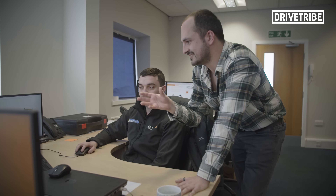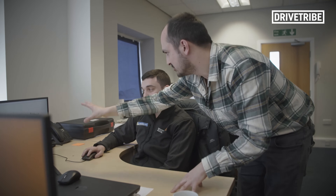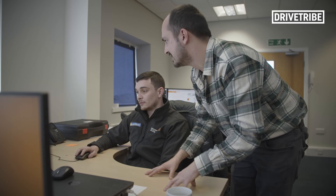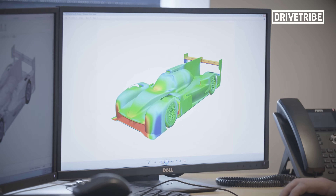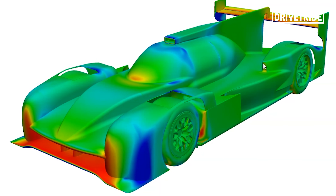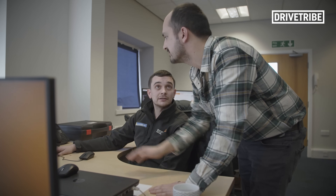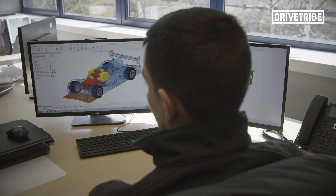That classic regulation of having a passenger seat in the car still exists for Le Mans — exactly. So if you look at our own P1 car today, we have to make sure the driver can get in and out both sides of the car. With the CFD model, you're simulating a wind tunnel essentially. What are you looking for in the CFD image? We're looking for a good correlation between what we thought would happen with our surface design and what's actually happening. In this case, we've got a high-pressure region on the rear wheel arch that we might not like because of our drag targets, so we may want to modify that shape and develop the car further.